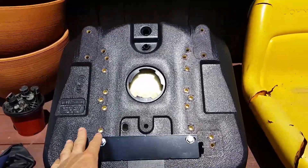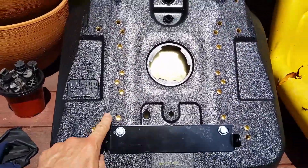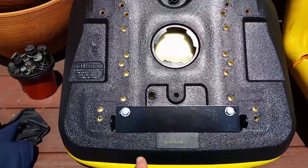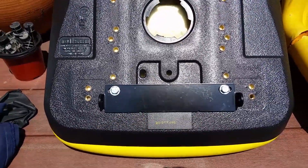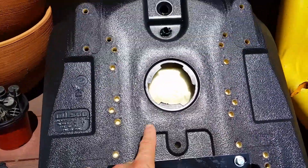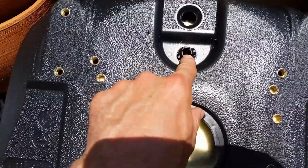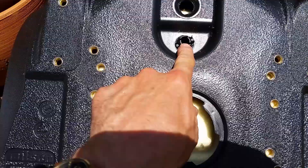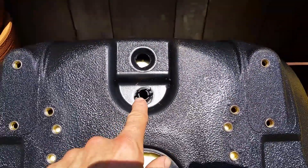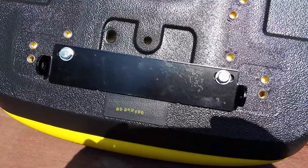On the bottom you can see it's just molded plastic. I don't think there's any metal on the seat whatsoever except for these little insets, which are set in fairly common positions — although it wasn't a common position to fit the original bracket from the John Deere tractor. The new bracket they ship with it also has a cutout for your operator present switch and a drain plug. The drain is from the top of the seat, so if the seat isn't up, water should drain out through there — although on my Massey I have a similar seat and it tends to get clogged with debris from trees. The two bolts and washers did come with the seat.